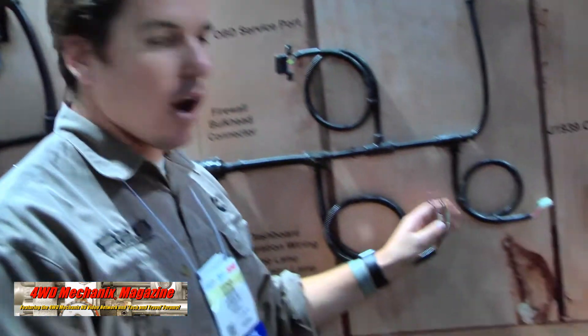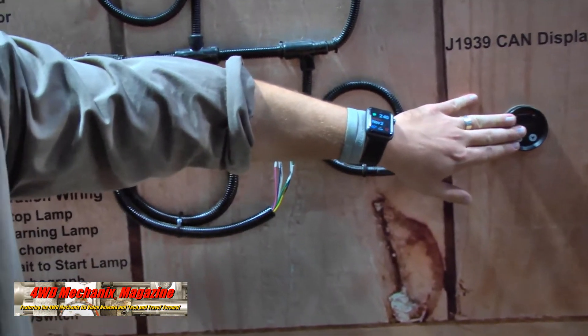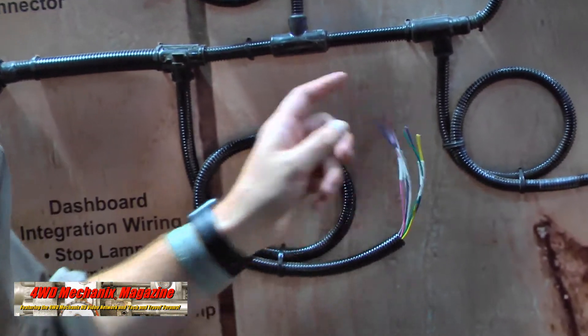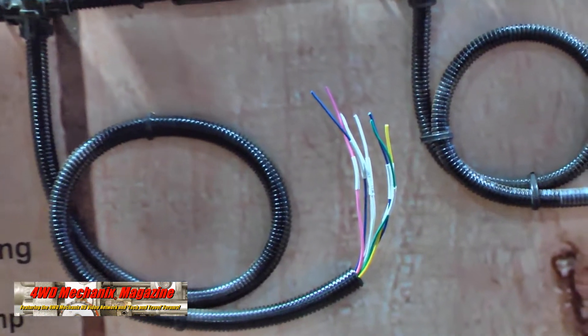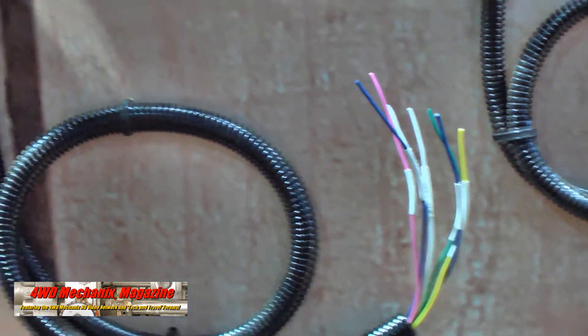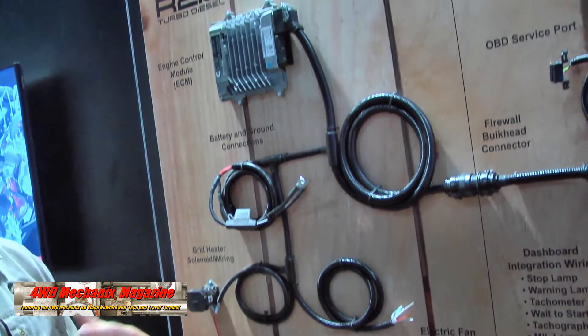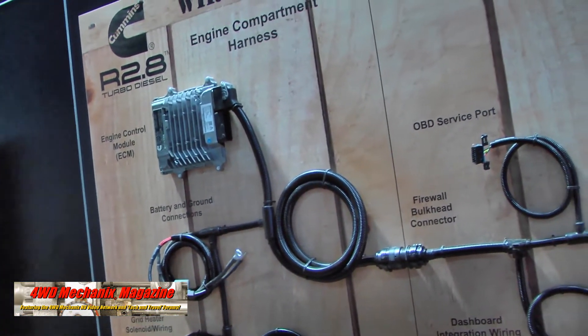The other wires are the wired dummy lights. Maybe you don't want that display, or maybe you want to wire a warning lamp or stop engine lamp separately. There's also a tach driver if you want to run another type of tach. If you don't know about diesel and J1939 CAN language, there are whole instrument clusters that run on J1939, so you can plug and play with those or upgrade to other Murphy, more elaborate displays.